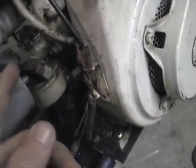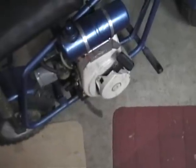And also the clutch, we've had quite a few problems with that. Actually, today I just had to tighten the bolt on the other side of the shroud, because my rip cord came out where you start the engine. It untangled and shot out and all this stuff, and it turns out there's a loose bolt in there, and the clutch had a lot of play to it. Like now it's nice and solid. The clutch had a lot of play to it, and it was knocking the chain off. It turned out all it was was that bolt on the other side, and I've messed with that thing before, and I never would have guessed that would have happened. And so I got that tightened down as tight as that'll go, so that should be one more problem that's checked off the list.